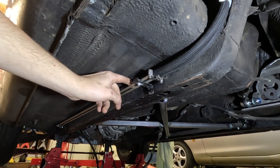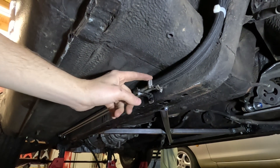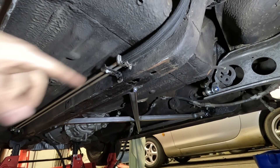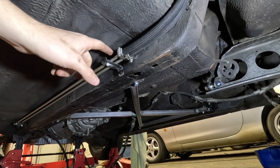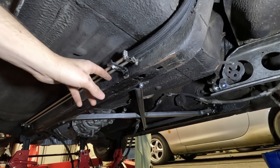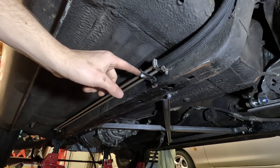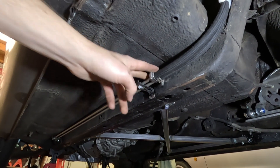After that you saw the installation of these hard lines. These are aluminum 8mm outside diameter hard lines and they've put a little barb on there with the welder — this is all hard mounted now. These little brackets are actually from the other side; they used to have a little plastic piece with clips that held the original fuel lines. We moved those over, removed the little clip, and added some holes for cable ties, though we ran out so we need to get some more for the last one.